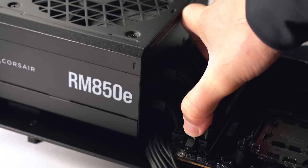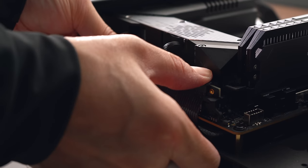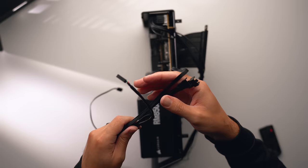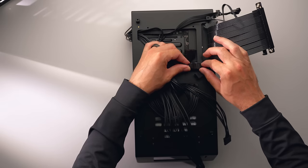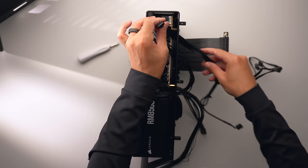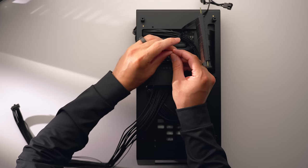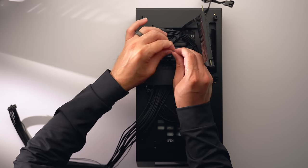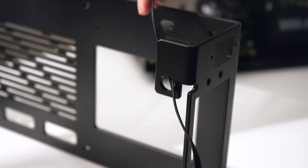Connect the CPU cable on the left, the motherboard connector, and the breakout card on the bottom. I removed the RAM temporarily to make these connections easier to reach. Then connect the PCIe riser cable and the USB 2.0 adapter on the left. Grab the breakout cable for the AIO and make the USB and SATA power connections, feeding that through to the front of the motherboard as well.